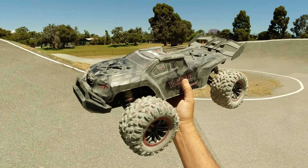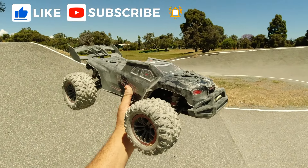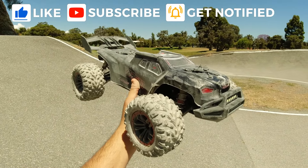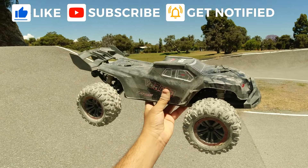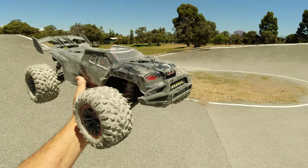The diffs however could definitely do with some thick oil — that's the next thing I'm going to do to this truck. That center diff as well needs looking at — I could probably guarantee there's hardly any oil in there at all. It's just too loose, and all the power when you take off goes to the front wheels before it goes to the rear. To even that out, definitely want to put some very heavy weight fluid in all the diffs before I take it out next. But other than those minor fixes with the oil and the diffs, this thing performed awesome for the price. It's only $250 — maybe even cheaper if there's a coupon code. I'll leave a link in the description below to HOSIM on Amazon as well as their website. For the money guys, you're getting pretty decent performance out of this Truggy.